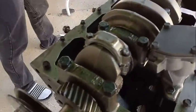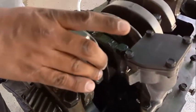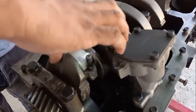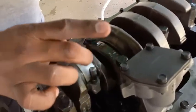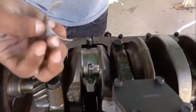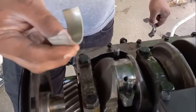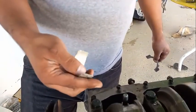We removed the nuts. This is a rod bearing. This is the cap. There's actually a bearing inside here. Most of us are familiar with bearings with little balls, but this is a different type of bearing — the principle is still the same. This is called a tang. Inspect the bearing, make sure it's not too scratched up. Whenever you do an overhaul, regardless, you're going to replace this.